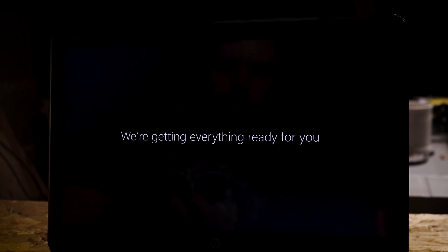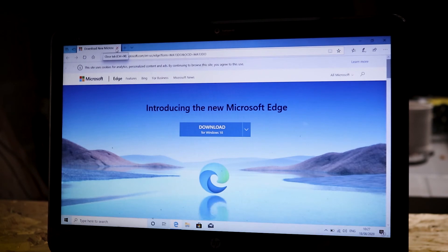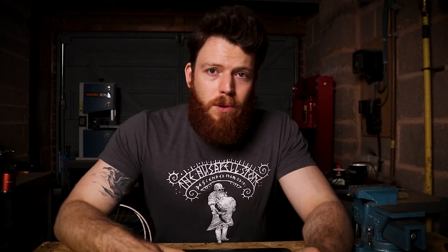And there we should have our install. You can see you can open stuff without really any loading screens whatsoever, and that's because of our new fast SSD. Shut that down now and take out the USB so it doesn't try to boot from that again. You might find it's a little bit slow the first time, but even then — pretty much instant. And there you go, you've just turned your old nasty laptop you were going to throw away into something that will keep up with most modern laptops. The best part is that only cost me £47, whereas a new laptop is going to send you into the hundreds or even thousands, and this will now last for a few more years. You can get SSDs even cheaper than that for about £30-£35 — I went with Samsung because I think they're the best and the fastest, but that's another topic.